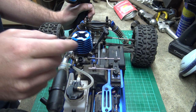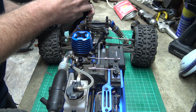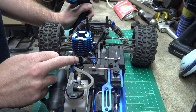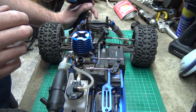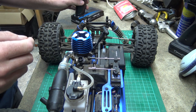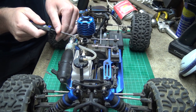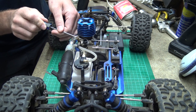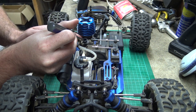If you've got the dial turned too far — say I've got it just below one at the moment — if I had it on number three, the tick over would be too high and the brakes would come on very soon when you press the brake. Now that we've got that set up properly, I want to show you what the tick over screw should do. Let me go and get a screwdriver. I'm going to take the screw out so I can show you what it actually is and how it works.